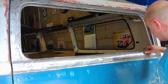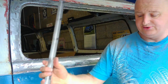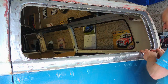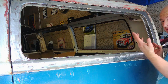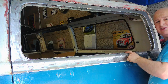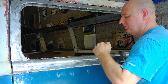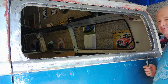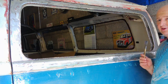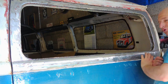The only area I need to repair is in here, and I'll do that with a repair panel I ordered quite a while ago. It's just a case of cutting out and welding in. Along here it's pitted slightly, so I'm basically going to put some rust converter on here just to future-proof it. Let that set, get some primer on the bare metal, and then move on to the repair.